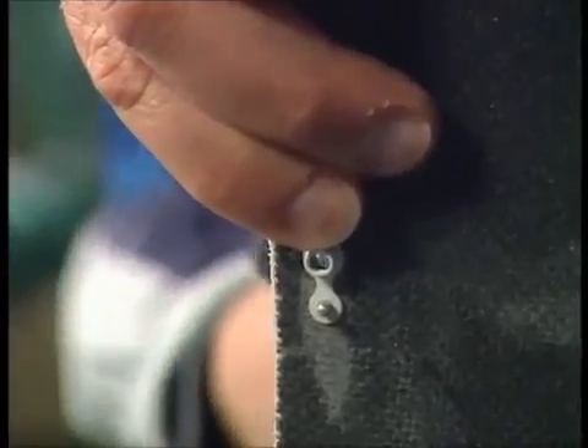The nut plate goes on the reverse side and is held in by a couple of little countersunk pop rivets, and then you just give it a big squeeze. There we go — it's nice and flush where the join is. Then the second panel will sit over the top, and a screw painted body colour will screw in and join the two panels together. So that's one down, 306 to go.